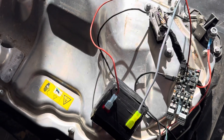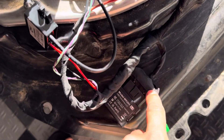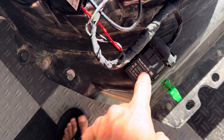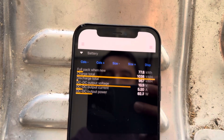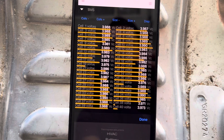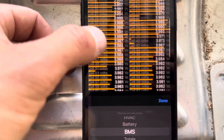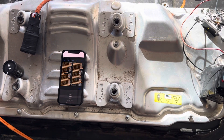In addition to all of this, what I also wired in — which is a totally separate system, don't confuse the two — I wired in an OBD2 adapter and hooked it up to a Bluetooth OBD2 adapter which is communicating with my phone. I'm running the ScanMyTesla app, so that shows you volts and amps, watts, and if you select BMS you're going to see individual cell voltages. I think that's pretty much it. If you have any questions, feel free to leave a comment. Thank you.